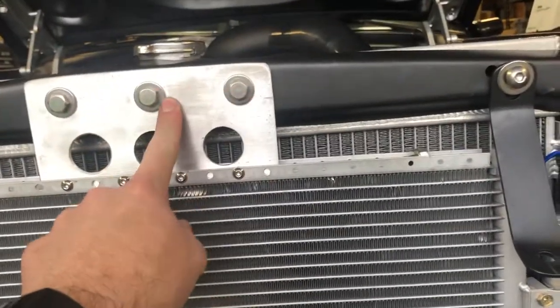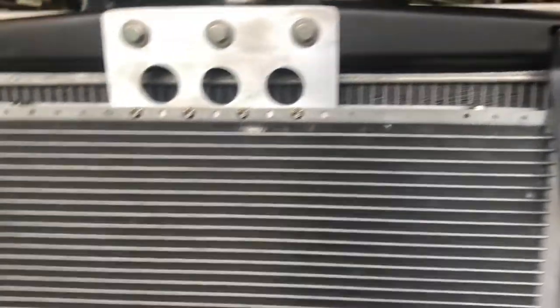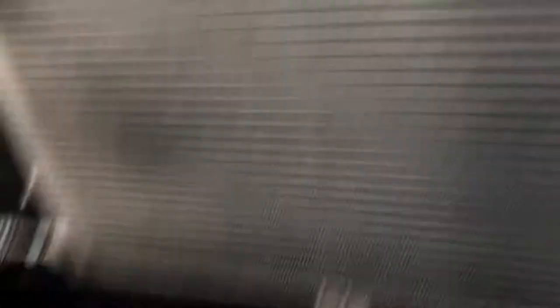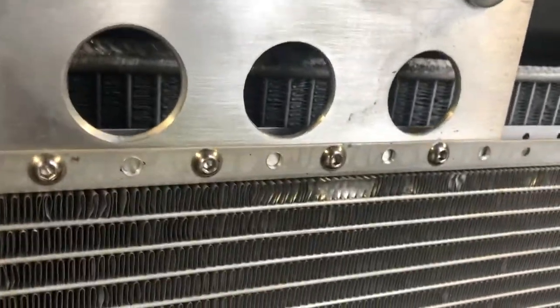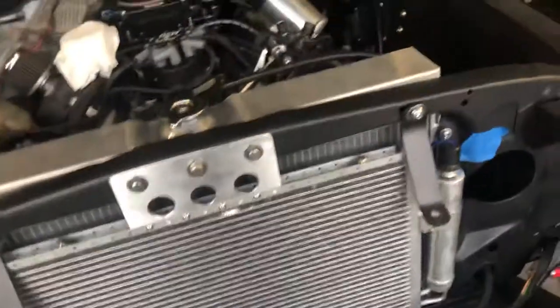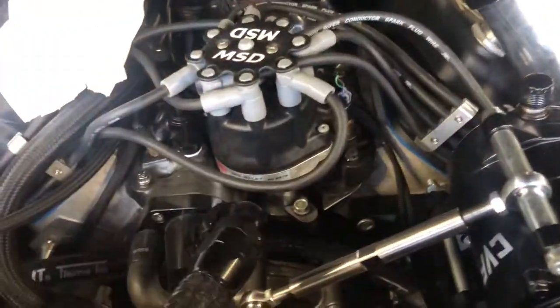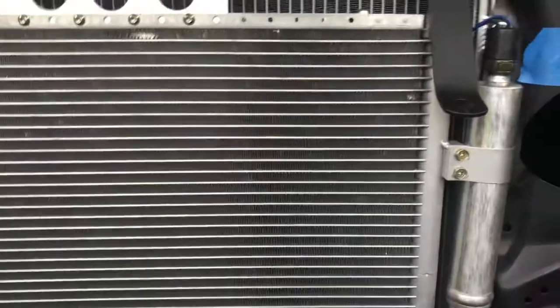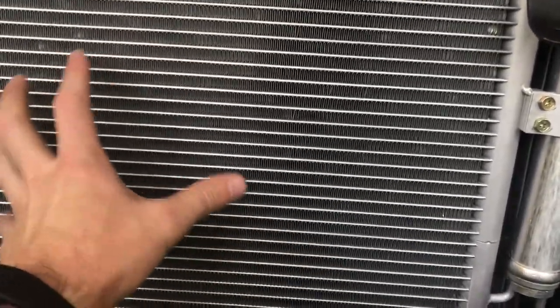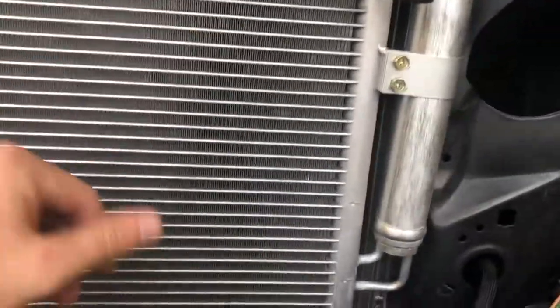This new condenser — I fabbed a bracket up and bolted it in the normal hinge spot. I think I can still use the hinge because I had to lower the intercooler and made new intercooler brackets, flipped them the opposite direction so it kicks it out further. There's a little clearance behind the condenser, and the intercooler has enough space that I think I can put a slim fan on the front and tie those two fans into the same trigger wire. The Holley would trigger the front one when the AC kicks on, plus it'll have a temp trigger as a third safety fan.